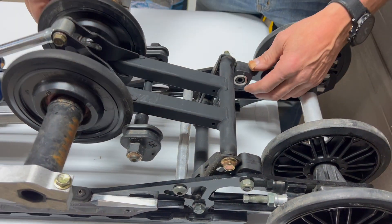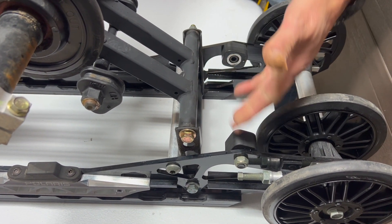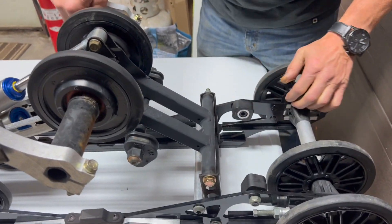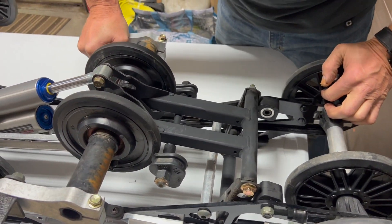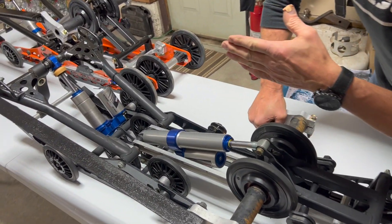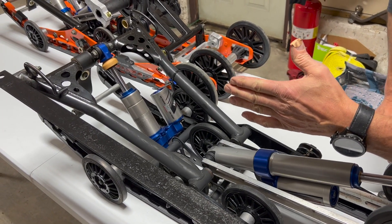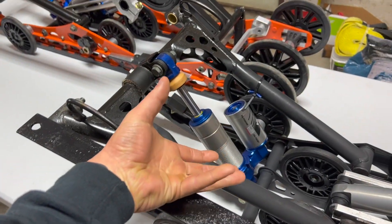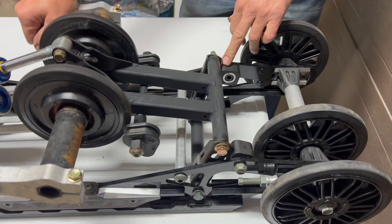Here's low, here's medium, here's high. When you push down, the farther this can go back the more it's going to wheelie. On medium it stops sooner, making the spring a little stiffer and keeping it from transferring as much. On high it gets like this and stops it more, making it stiffer. Actually when you go to high and it goes through its travel, it pushes the nose just a little bit from geometry - it's wanting to lift the front, taking a little pressure off the nose. So on high you get the least amount of transfer and it also picks it up a bit.